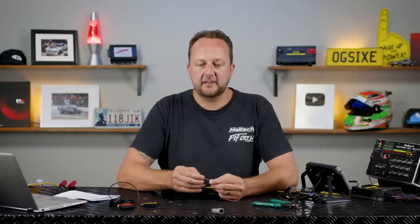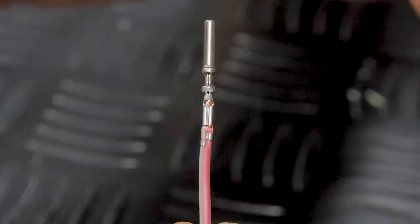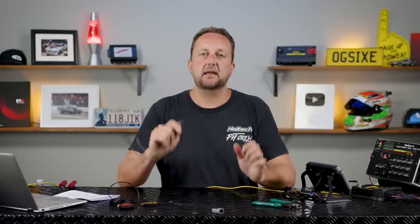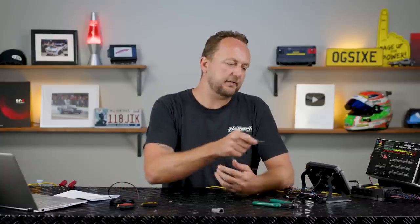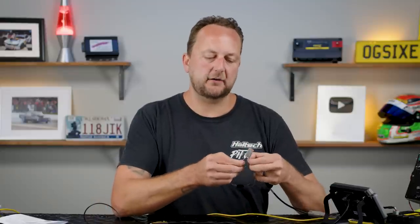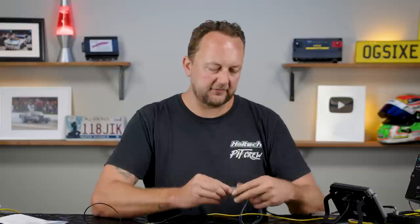If you strip the right length off the wire, crimp onto the insulation with the back side of the pin, and use the right crimpers, there's absolutely no reason why you'd be wrestling to get this pin into your AMP 1mm connector — it should be a seamless effort. If you're having problems getting the pin in, pull it out, have a look at what's going on, check over your crimps, start again, re-crimp, get it back in — it should slide in effortlessly. In our breakout Deutsch connector I've got my switched power, signal wire, and signal ground. I plug that into my GPS puck and plug my dash back in.